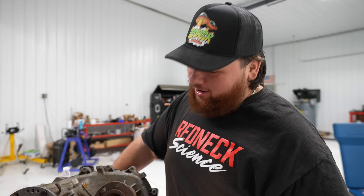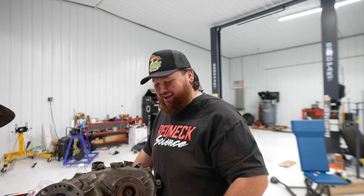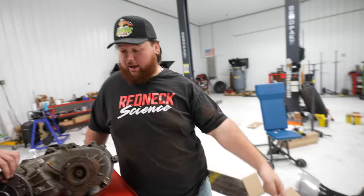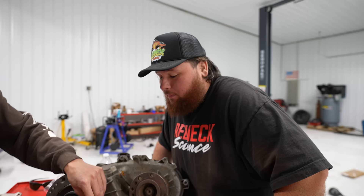We have to figure out how to make a hellcat four-wheel drive, and that is a lot harder than it sounds. We pulled out the old transmission. We have a turbo 400 sitting right there, an adapter, a clocking ring, and a transfer case out of a 1992 Chevy pickup — which will hold 700 horsepower, because that's basically what they made back in the day. Also, this transfer case screwed up my back — I slipped a disc — so I'm hobbling around like an old man. We're going to see if we can put this transfer case onto that turbo 400.